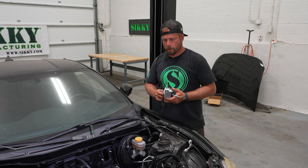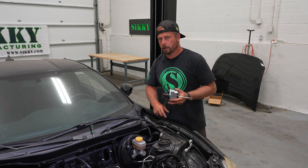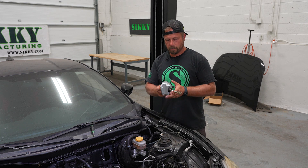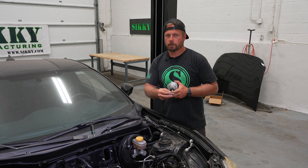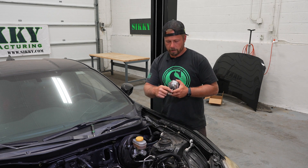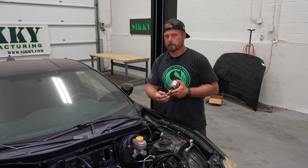All right, two quick things to go over before we permanently bolt this to the firewall — that's going to save you a little bit of headache. You're going to want to do a bench bleed on this master cylinder. I'm not going to get into that process — there's plenty of videos online about it, even Wilwood has one on their particular master cylinder. So do a bench bleed, that'll save you some headaches. The other thing is check your pin fitting. This factory pin from your clutch pedal is going to go through this clevis here — it's a pretty tight fit. What I would recommend: make sure it goes in and out easy enough, but you don't want it loose. If you do need to open it up just a tiny bit, a 5/16 drill bit will knock any burrs off or whatever it might be — even just the plating thickness can make it inconsistent. Check that now — it's much easier to do it prior to getting under the dash to hook this thing up.